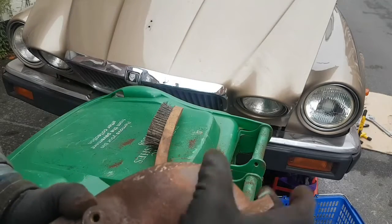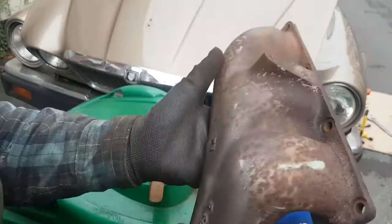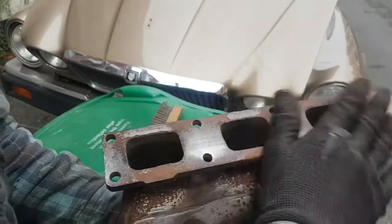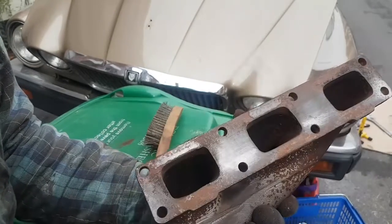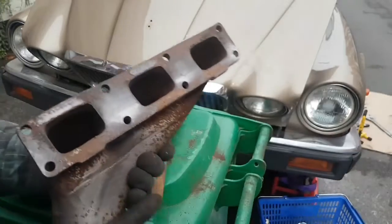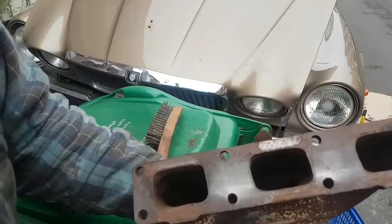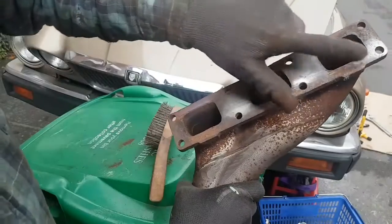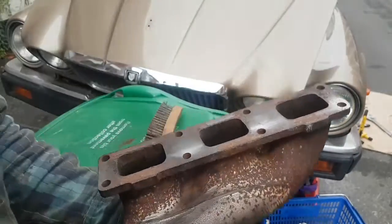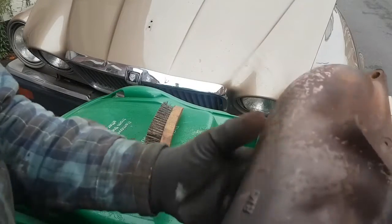I'm working in the street, on the road - I don't want to get myself run over. It's a city centre street, not the suburbs. I'll spend about an hour really cleaning that up. I might use a rotary drill wire brush on the outer areas, but I'll definitely do the inner sealing face completely by hand, then use finer paper - probably finishing at 180 grit, maybe 240, because the stuff I've been using is 80 grit. That should give a really good flat finish. The high spots are shiny, the low spots are still rusty. It could be done by machine but I haven't got access to one.